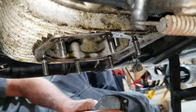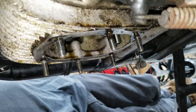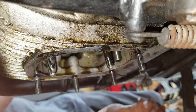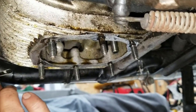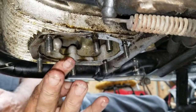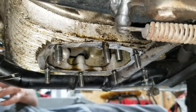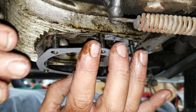Recently, the top end, like the rocker box cover and stuff, they're all just riddled with RTV. And so were the carburetors, but this wasn't, so I don't think they were into this, which is probably okay. But anyway, what do you think? I think if we put anything on it, we put that Loctite stuff on it. Yeah, the problem is it's wet. It's gonna continue to be wet. And you're supposed to put that stuff on in a dry, clean environment. We don't really need anything on it. I'm guessing we're just going to do this.